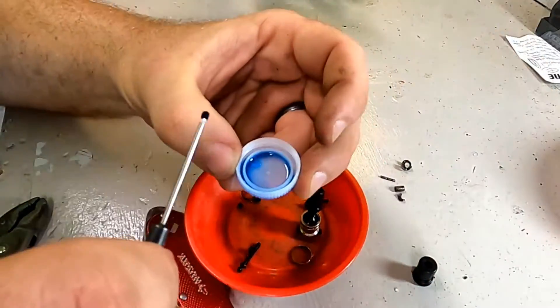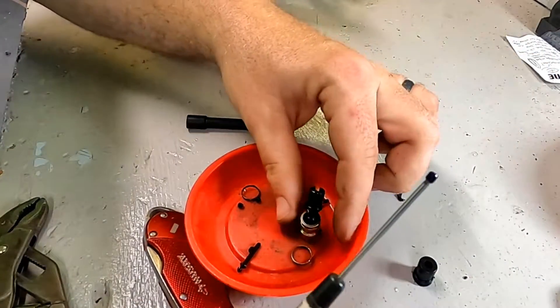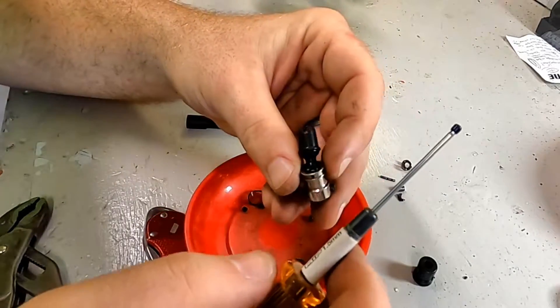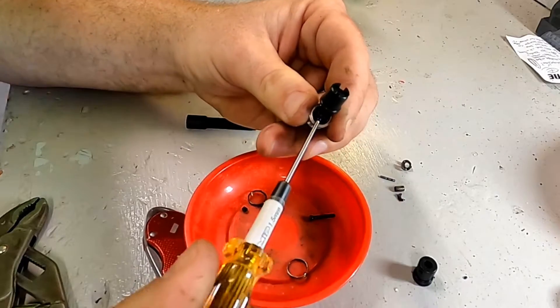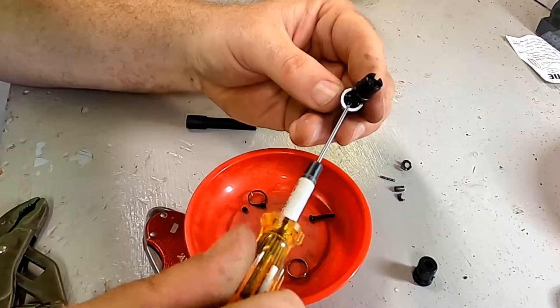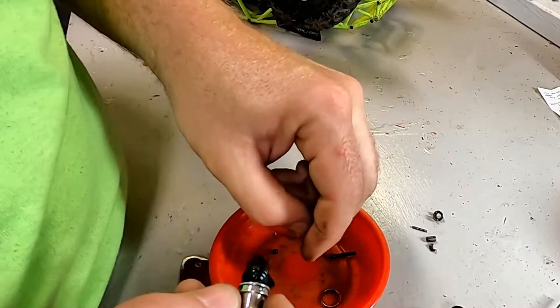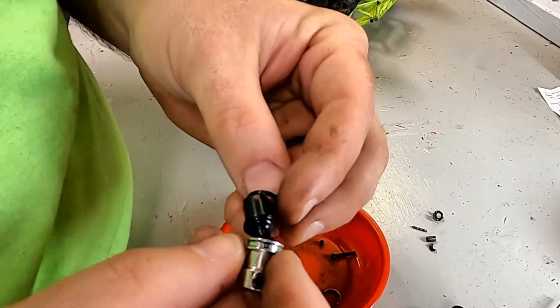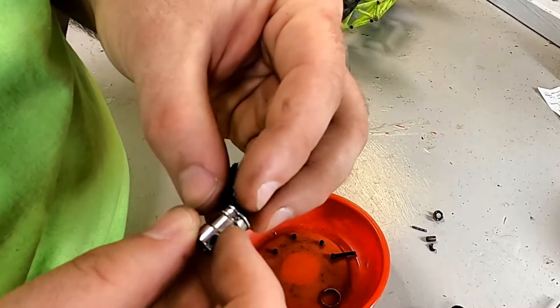This is actually how the MIP shafts are held together, and that is a much stronger joint at the end of the day. This is a piece that needs some Loctite on it — I have some Loctite here from a different project. We are going to run the screw in here, assuming it's the right screw because we have a couple here. It also still provides the spring retainer to go over it, so might as well use both.